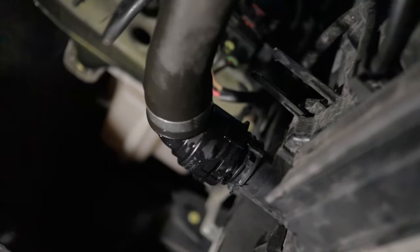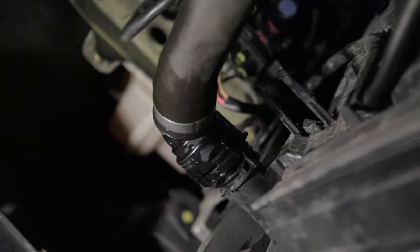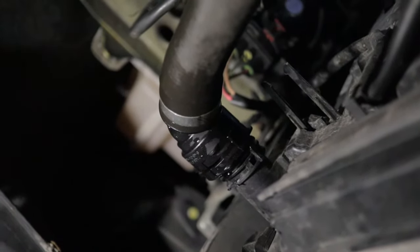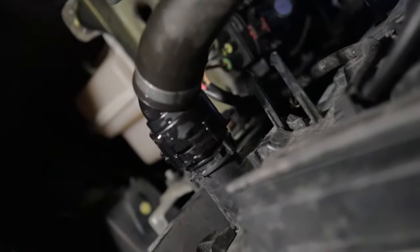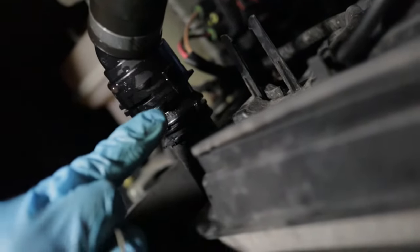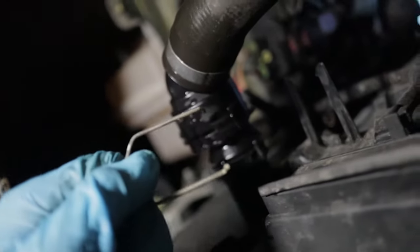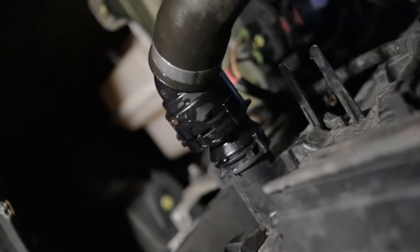I removed the main hose because it gets most of the fluid out rather quickly. A word of advice: be ready to get wet with coolant — there's no easy way around it. The hose has a clip which locks around it in slots. You don't have to fully remove the clip, but I did to give myself room to wiggle the hose around. Just make sure you note which position the clip was in so you can put it back the same way.